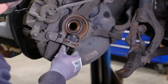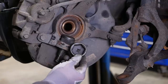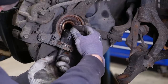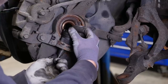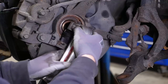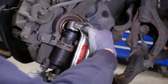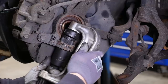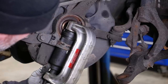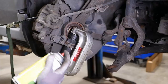Okay, now we gotta rig up enough adapters to install that ball joint. That's a filter socket for Super Duty Fords, 36 millimeter. Works on the Power Stroke fuel filters and whatnot. At least get us started. Close it down with some Weasel Whiz.